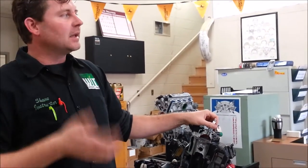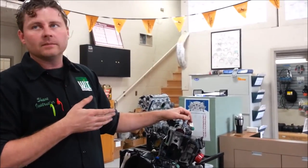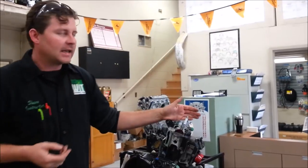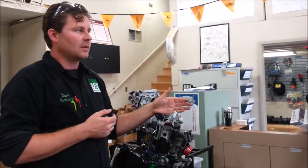So let's look into the big cause — the common cause of pre-ignition is poor fuel. If the manual calls for 87 octane, 89 octane, or a premium octane and you use something less than that, you're asking for trouble.